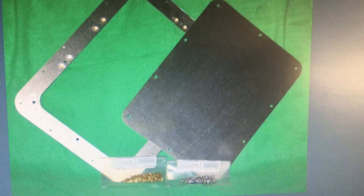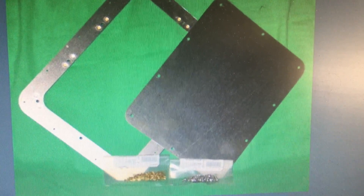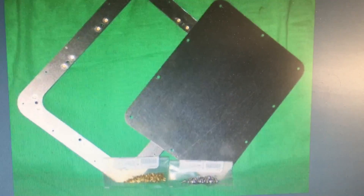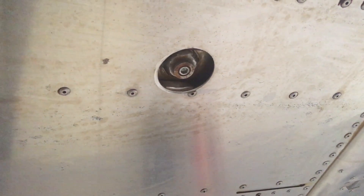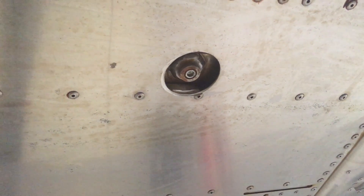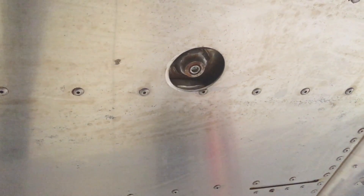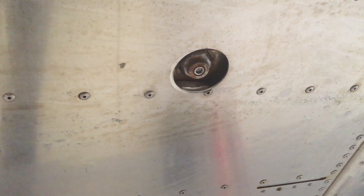It's easier if the fuel tank is sitting on your bench, but you can make access panels. Viking sells a nice access panel with the frame already built, access cover, and nut plates installed, making it very easy to create an access panel in the bottom of the wing. Here's the bottom of a Zenith wing — an access panel could be installed, then the hole made in the tank and the pumps inserted using the half shells and sealing washers, as long as everything was cleaned properly.